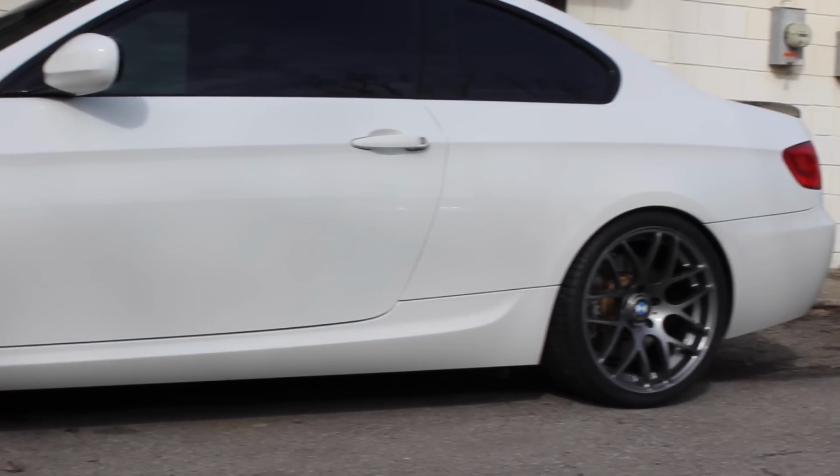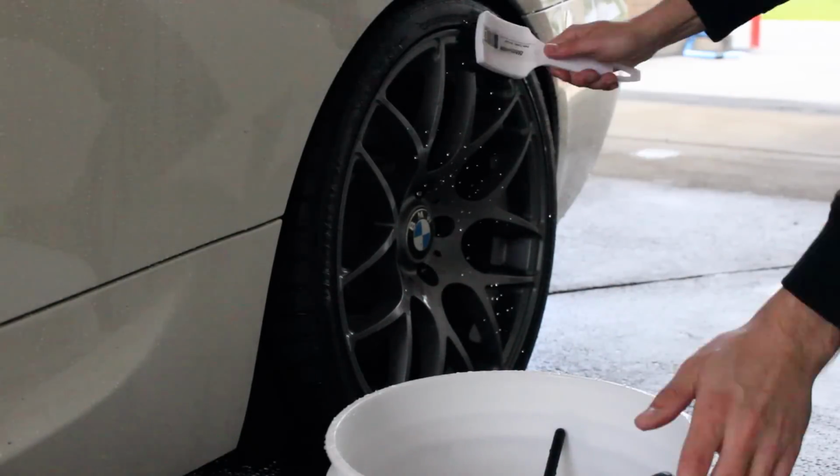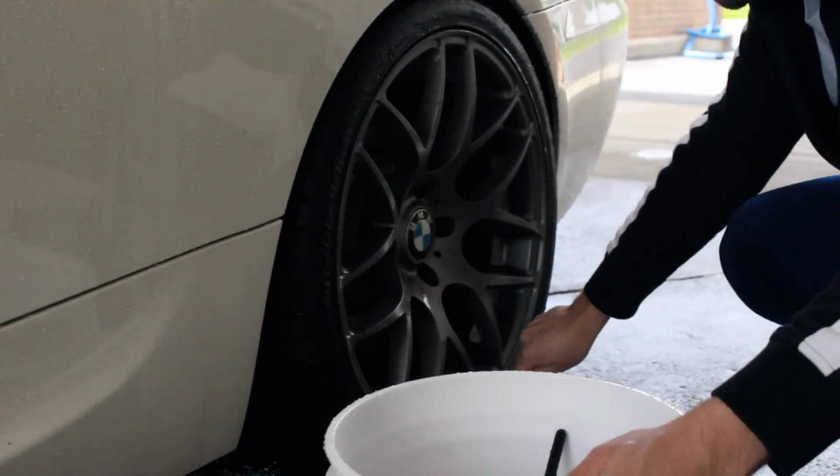And lastly, I want to talk about tires. If you go from 18 to 19, so the wheel is actually bigger, the profile of the tire, you'll want to go a step or two down depending on how much you change, which will have an effect or not have an effect on your speedometer and the miles and all that. You don't want to go from a 15 to a 20 and have the same profile tires if you can help it. So that's going to make a big difference as far as your odometer and your speedometer, everything. You don't want to be racking up the miles because the wheel is all messed up as far as sizing goes.